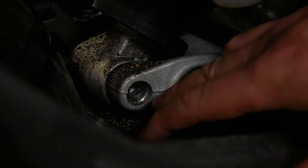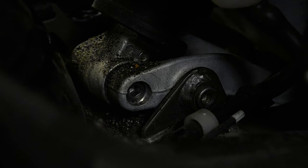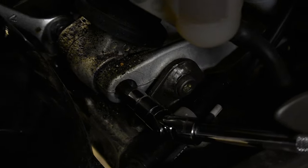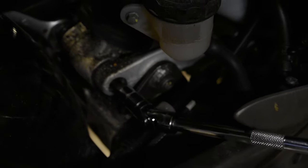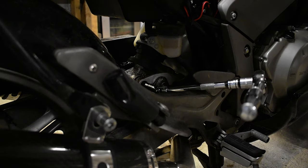Next we're going to remove the bottom bolt down here. The size is an 8mm allen — let's see if there's space to get in at it. Quick walkthrough: it's a bit of a dickhead move from Honda. You put together this contraption — 8mm allen on one side, and on the other you need a 17mm spanner, but there's no space for a spanner or socket down there. It does work once you put it together, so let's loosen this and open the bottom end.